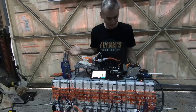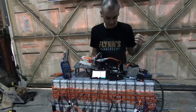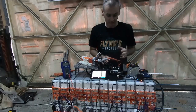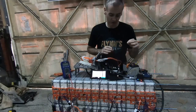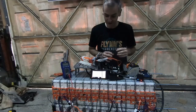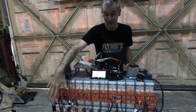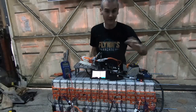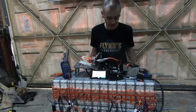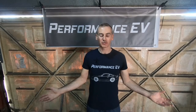The battery's got power, so I'll tidy up the wiring. When we get close to putting it in the car I'll start to work out where things like the inverter are going to be specifically, work out where the high voltage junction box needs to go, and figure out the final internal wiring both for the power coming from the battery and the module itself. So there we have it — we actually have a working battery and it's got about 50% charge, which is pretty awesome. It seems in really good health and I didn't blow up the BMS even though I did have a bit of a scare.